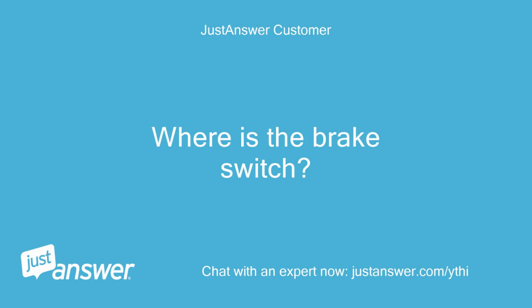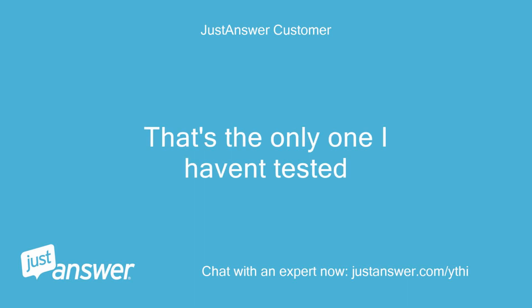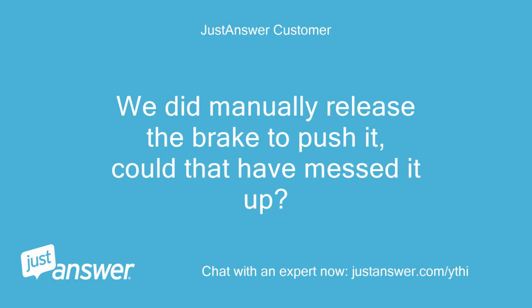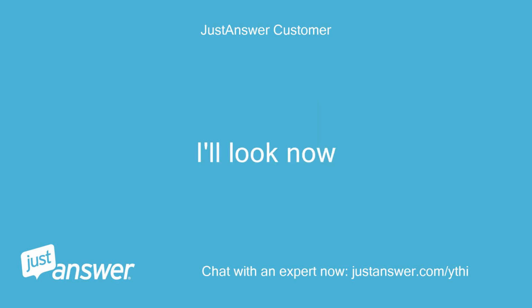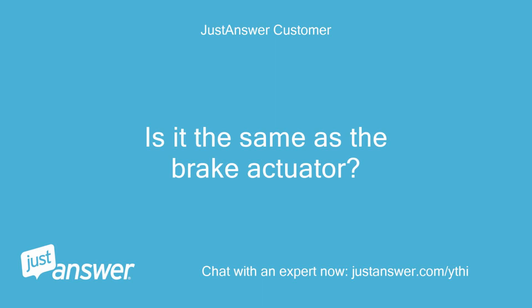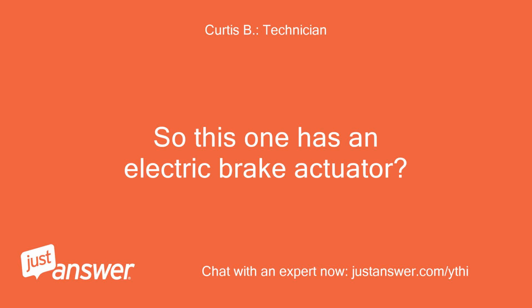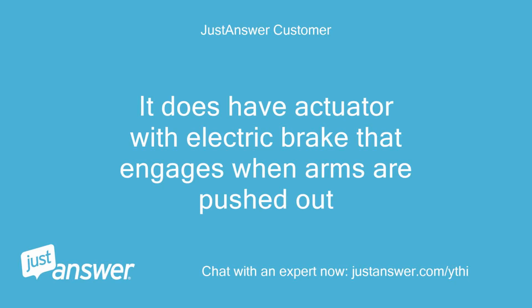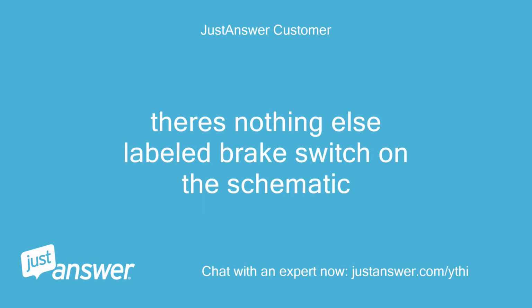Where is the brake switch? That's the only one I haven't tested. On the frame where the brake linkage can push it. We did manually release the brake to push it, could that have messed it up? I'll look now. Is it the same as the brake actuator? So this one has an electric brake actuator? Not sure what it has for a brake switch. It does have an actuator with electric brake that engages when arms are pushed out. There's nothing else labeled brake switch on the schematic. Then there is none.